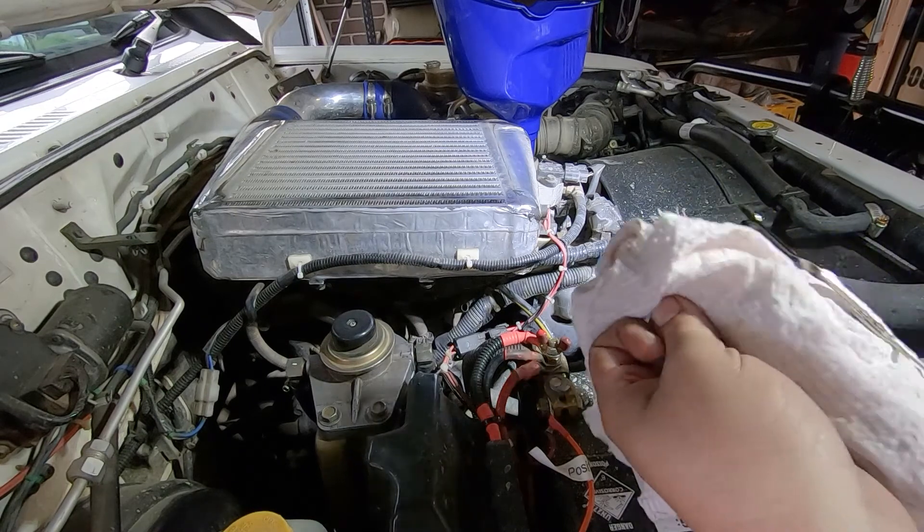And now I've got to go for a drive. Alright, well the oil change is done. I've checked the levels. Now I'm going out for a bit of a drive. I'll come home, let the car settle for five minutes, check the level on the dipstick again — if it needs a top-up, I'll top it up. Otherwise it should be right to go. As I said, really simple. Head down to your local Auto One, set aside an hour this weekend, and save yourself a few bucks.